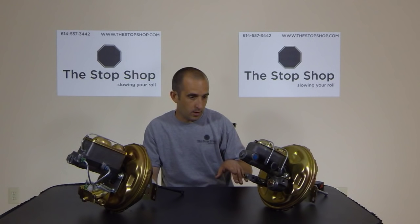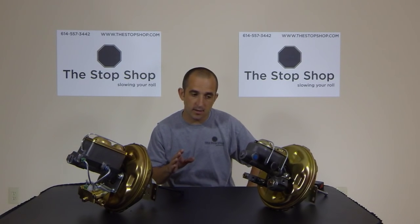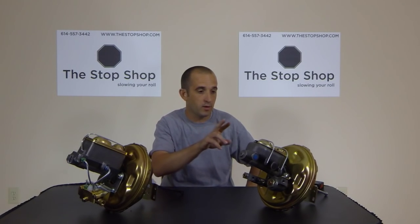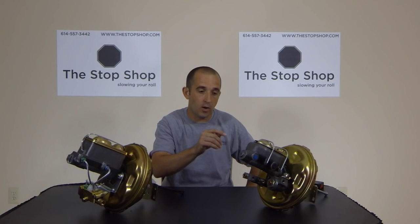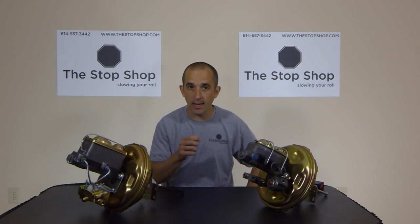So let's get back to choosing the correct line set and knowing what valves are on the vehicle. 1967 through 1970 on these cars they all have a dual master cylinder. 1967 was the first year that the government mandated that all vehicles come off the line with two lines coming off your master cylinder and that they all have a brake warning light. You'll see that there's a prong on the factory distribution block for a wire to run up to the dash, and that would turn on a little light if you lose pressure from either the front or rear brakes.